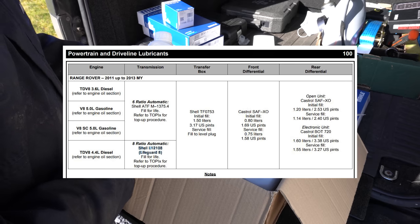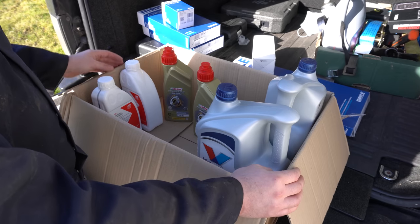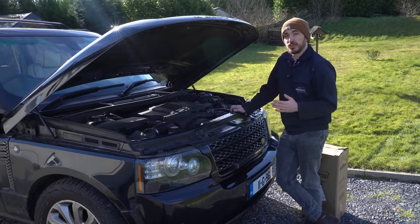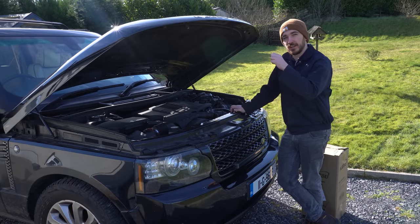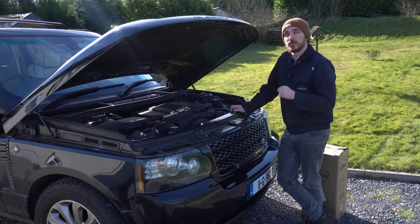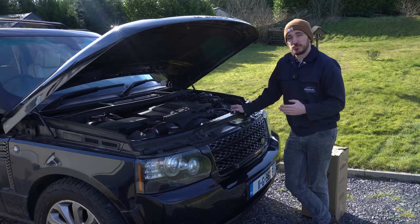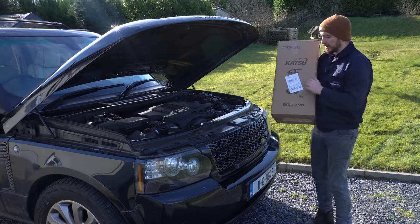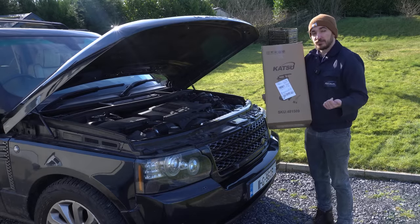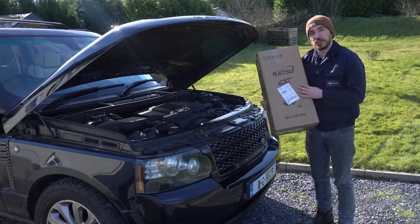As I've just been to the boot fair the engine is nice and warm, so I'm going to get started with the engine oil. Last time I changed the oil on the Range Rover about 12 months ago I drained it out the bottom of the sump using the quick connector oil return, but that's not actually the way Land Rover recommend you do it. They actually recommend you suck it out using a suction pump, so I've bought myself a new nine-litre oil suction pump off Amazon. I'll leave a link in the description below.